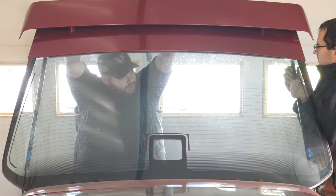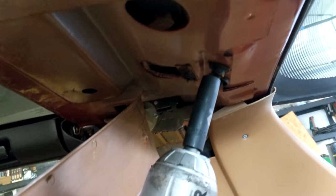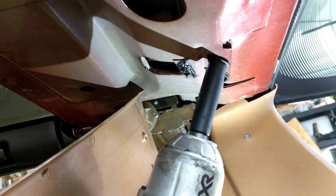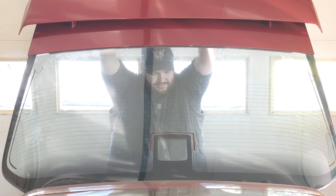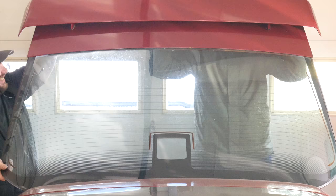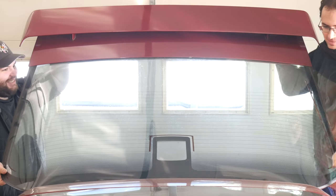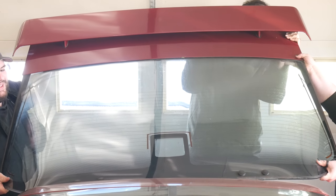Just like we showed when we installed these in episode two, there's just one bolt at the top to remove and then they can be slid off. Then I'll wedge myself into the back seat with the impact gun and loosen the four fasteners. There is sealant on these so the impact gun is a big help. The hatch is secured with four nuts and once they've been removed the thing is ready to lift off. Because of the size and weight of the assembly, I wouldn't even think about trying this alone — it would be pretty tragic to break this piece of glass. Between the glass, the deck lid, and the spoiler, the whole assembly weighs around a hundred pounds. We actually used three pairs of hands to lift the hinges away.